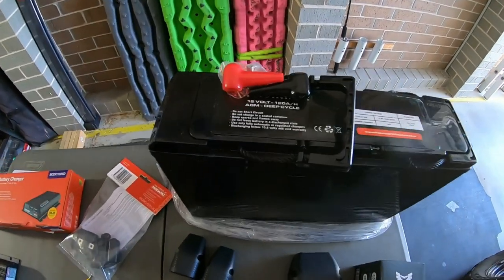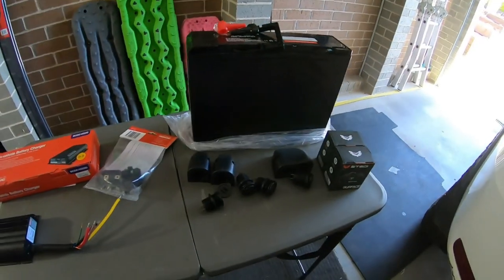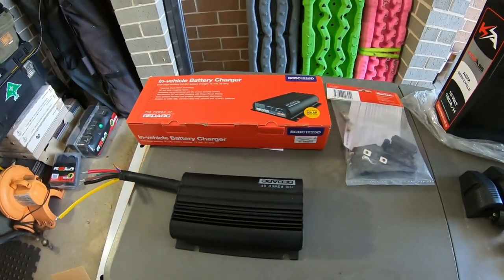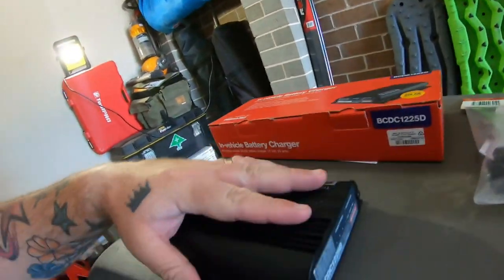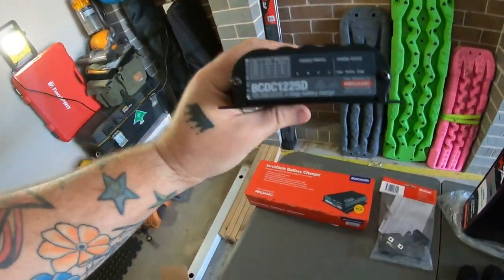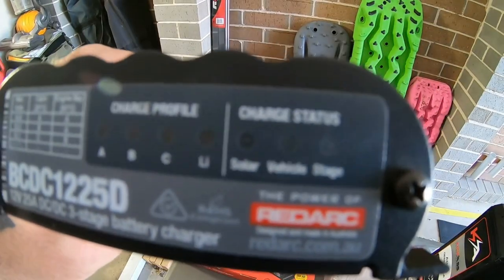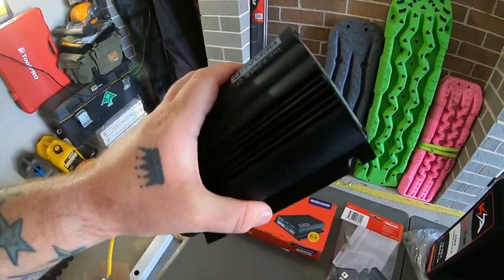So this is the plan — I'm gonna make this the easiest setup I possibly can. I've got a slimline 120 amp hour AGM deep cycle battery which I'm gonna mount behind the drawer. The brains of the whole operation is gonna be a Redarc BCDC 1225D. What this does is it charges at 25 amps an hour, and the D means it's got solar input as well. We're not going to set solar up today. I love this little unit — it's basically the size of my hand. On the front it's got a heap of different charge profiles, so it's pretty much good for every battery ever made including lithium, and it just gives you a couple of lights to tell your charge status — whether it's car, solar, what stage of charge it's in. Basically a tiny little simple unit — gonna bolt it to the side of the drawer.